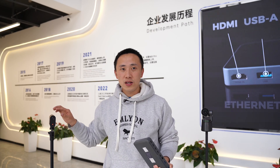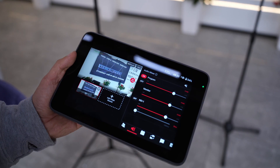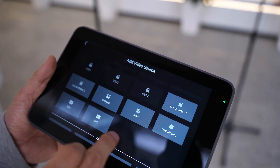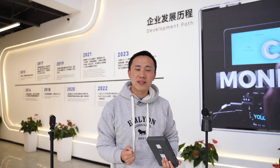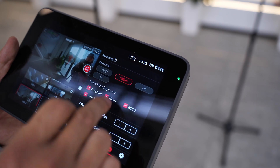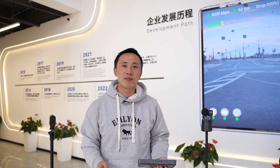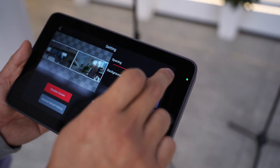Now since all the NDI cameras are connected with the smartphone, the next step is to add the NDI source to the YoloBox Ultra. To function properly, please make sure that your NDI devices and YoloBox Ultra are on the same network, whether it's Wi-Fi or Ethernet. Now that three cameras are all connected wirelessly, I can not only record each NDI video source with the ISO recording feature, but also live stream and switch with them simultaneously, whether it is to add graphic overlays or create various multi-views.